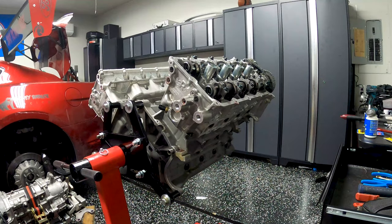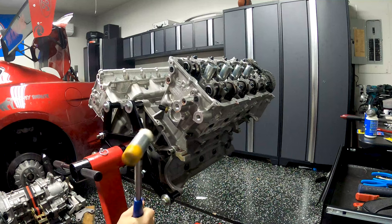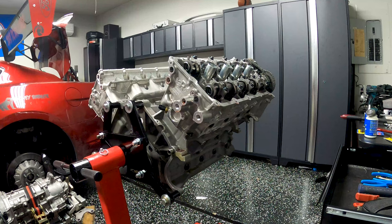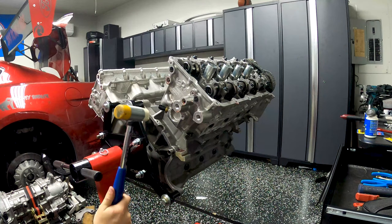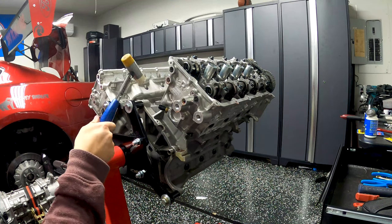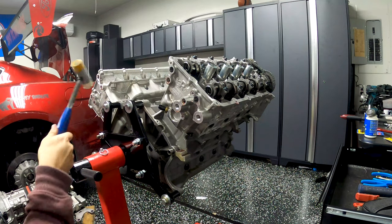I just went ahead and did this on the other side. Before the plug pivots in the hole, the whole plug is going to move in toward the head a little bit. Keep in mind that if you're doing this with an engine that isn't dry — meaning with coolant inside — a lot of coolant is going to come out. Draining the radiator only drains the coolant from the water pump area, the hoses, and the radiator; there's still going to be a lot of coolant left in the heads.